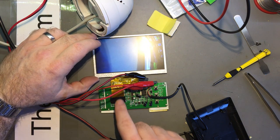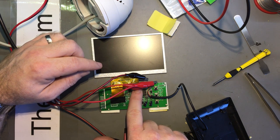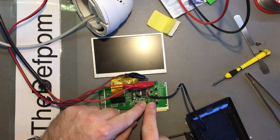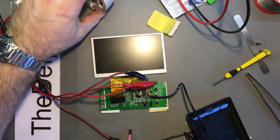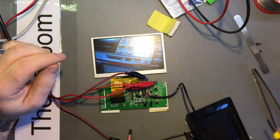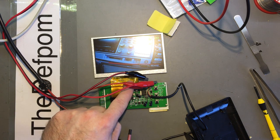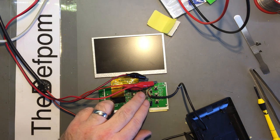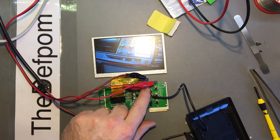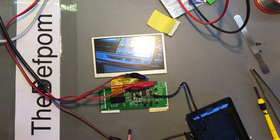The question is, is it the backlight or is it the video feed? Is it something in this ribbon or is it something somewhere else? To me it looks like a connection or something somewhere - it could be a bad capacitor, very likely a bad capacitor. But at least now I can actually bench test it. Moving the ribbon cable or flex cable around is not changing anything.